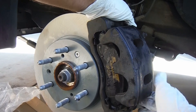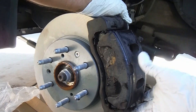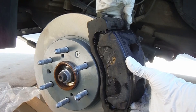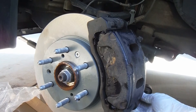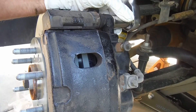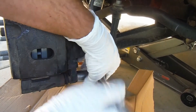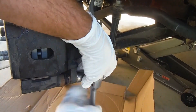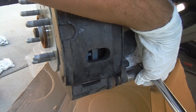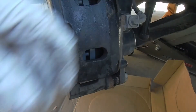Just pull those slide pins in a little bit if needed. It's a good idea to pull the slide pins out and grease them up, but I already did — they're still nice and clean with plenty of grease so we're going to leave them. On these caliper bolts, just get those nice and tight into those slide pins. I will look up the torque spec and put it in the description.